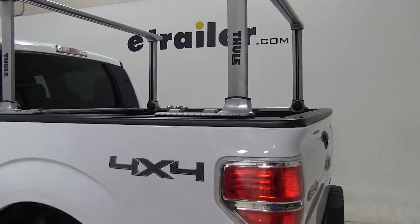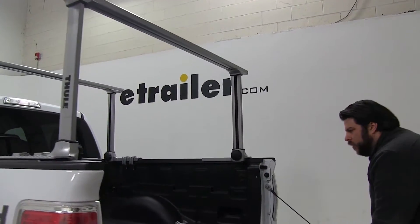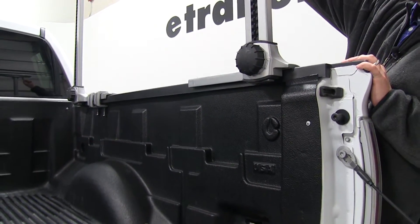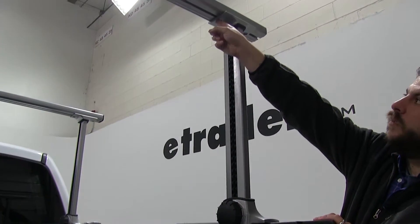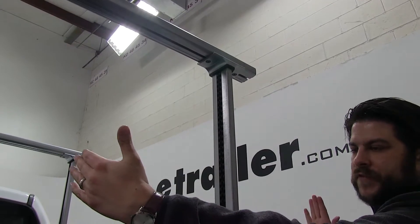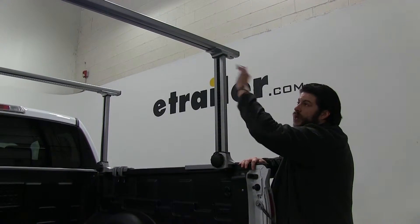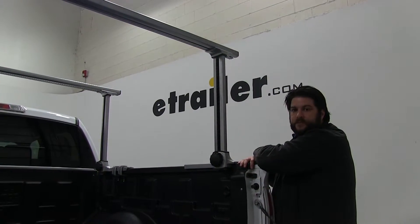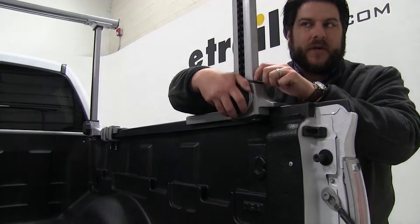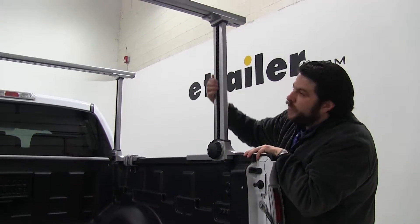Let's go around here and attach the last one. I'll go ahead and open up the tailgate so you can see a little bit better. If you need to adjust these to your truck bed, there are two points you can go to — here and here — which you can loosen up to adjust the feet in to accommodate different sized truck beds, and there's going to be those screws on all feet. Also if you want to adjust the height, you have these quick dial knobs here, which you loosen by turning left, and you can adjust it to the corresponding heights, which you can see listed on these black portions.